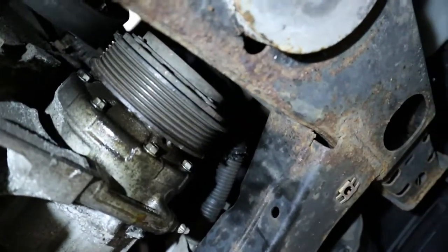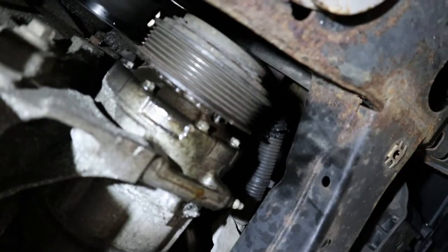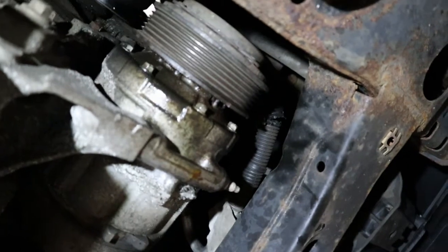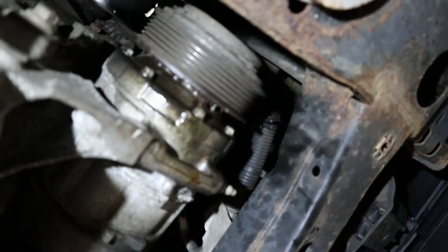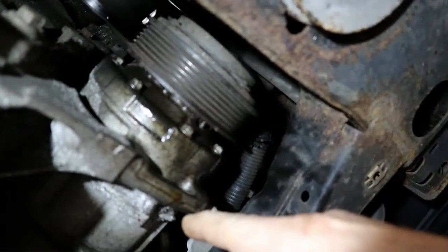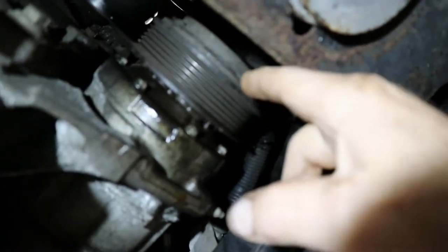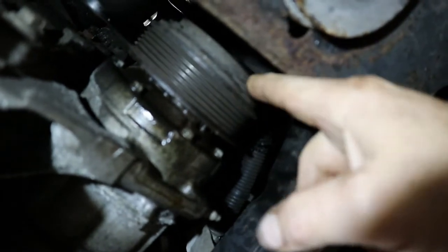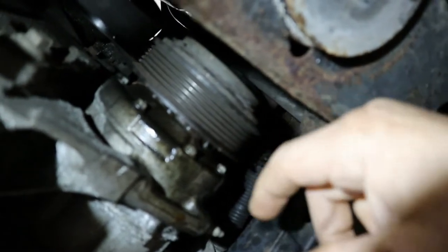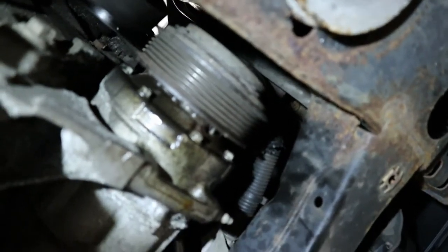Now keep in mind that this AC system was depleted of refrigerant. It's got a leak somewhere else. It's got over 140,000 miles on this vehicle, so it's really not worth putting the whole AC compressor in it. A lot of you might be saying, why not put a bypass pulley in? A bypass pulley system omits the AC compressor and is just a pulley with a bearing that takes its place. I tried to get the AC compressor clutch assembly separate, but that's not available. A bypass system is available for some of the F-150s, but not for the Ford Explorer application.